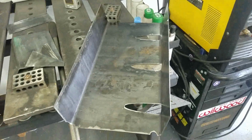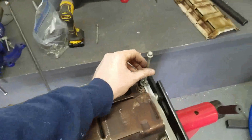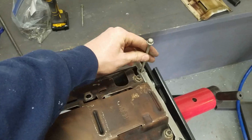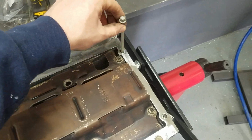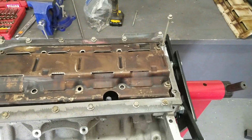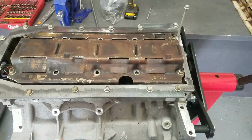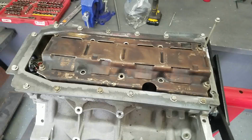No problem there. So what I'm going to do next, I'm going to cut out the tubes for the back risers. This is the back bolt, the factory back bolt, which is way too long. I'm going to cut the tube extra long. It'll stick out past. We'll just tack it in place, and we'll use these bolts to sort of clamp it there so everything threads in nice. Then when we're finished welding it, we'll lop it off to the correct height and then just seam weld it the rest of the way out.